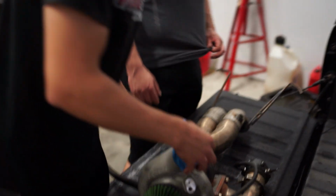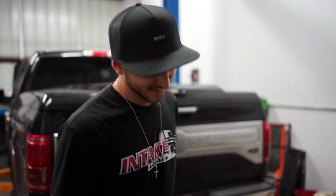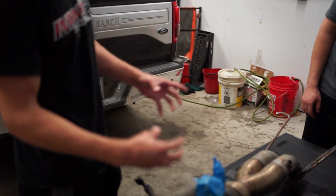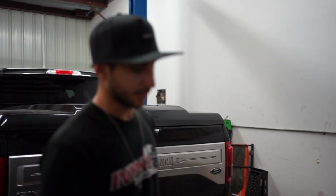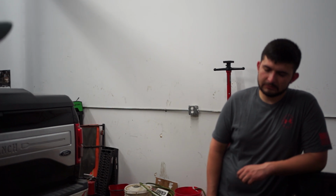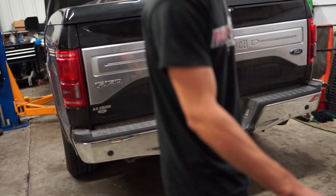So your problem was you're throwing oil. Yeah, because when I first put the turbo on there it wasn't fully connected, and we accidentally did something that was pushing too much pressure on it. It sounded like a jet engine or a little RC car. I think because all that happened, when we connected it properly and everything was said and done, it was pushing oil through the cold side to the intake. When we took it out, there was oil coming out of it. So I want to open her up and see if there are any damaged parts. Later on I'll start playing around with putting it back on Little Blue, until the V8 parts come in. I'm going to have a little bit of fun.